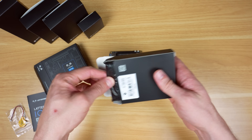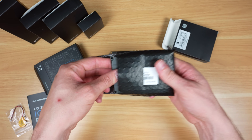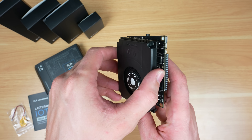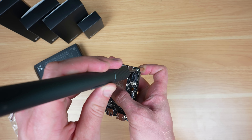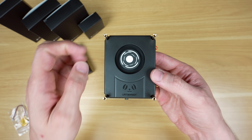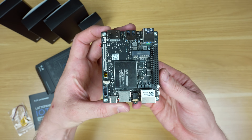The Iota has a configurable TDP in the range of 6W to 15W, which allows you to balance performance against power or heat. At a lower TDP it can run completely silently with a large passive heatsink, or you can crank it up to improve performance and use an active cooler, which is what I've got for it.